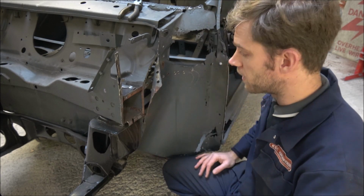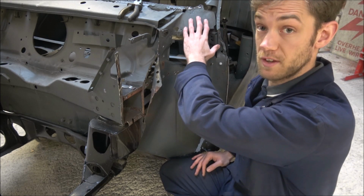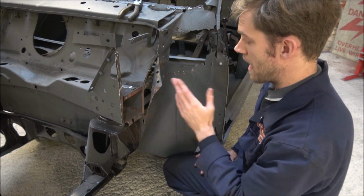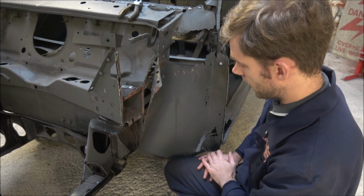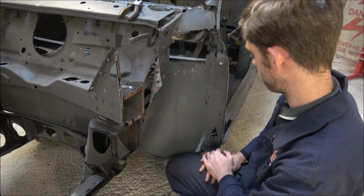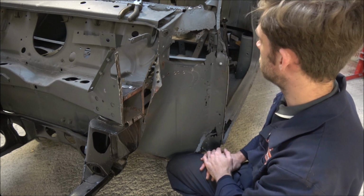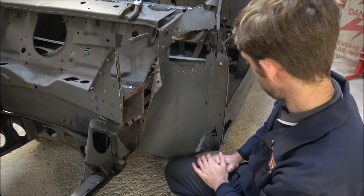Where I can see the spot welds, I mean, there will be obvious areas like up here where it's just not practical to use it, so we'll just get the grinder out and cut it with the grinder. But areas where it's still fairly reasonable, like around here, then I think absolutely it's the tool for the job. So I'll give these a couple more cuts. I may just come in with the grinder again, and we'll get all this off fairly quickly, I think.